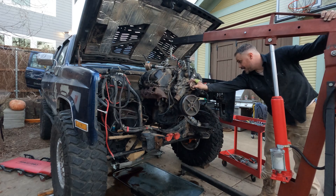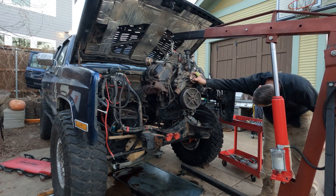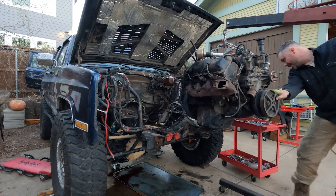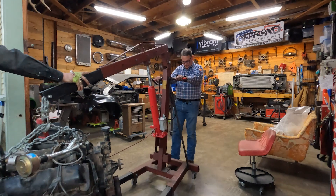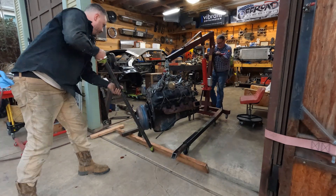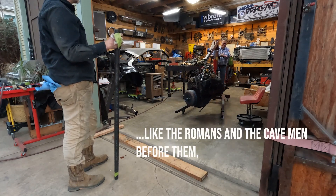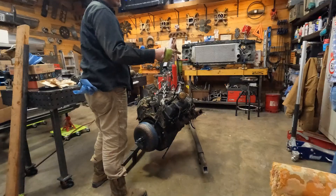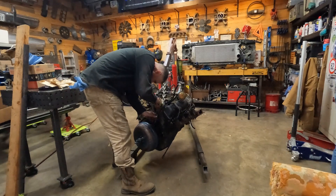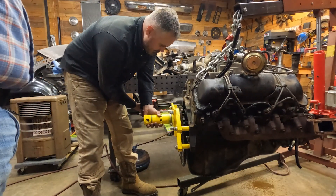The off-road design engine cage wraps around the 6.2 liter pretty snugly, but at the time I built it, I had left enough room to wiggle and work this engine out, even with the added complication of needing to bring the torque converter out along with it. You pretty much have to pull the engine straight forward to get the hub to clear the seals and splined input shaft, and you know you're going to kill the input seal through this process, so be sure to service that before putting everything back together. Like the Romans and cavemen before them, the lever reigns supreme. From there, it's just a matter of getting it in the shop and on the stand and making preparations for some exploratory surgery.